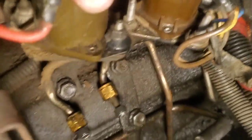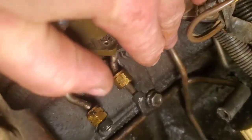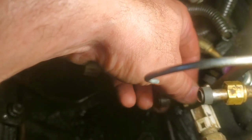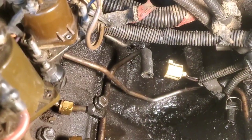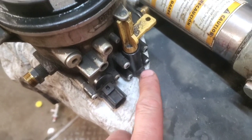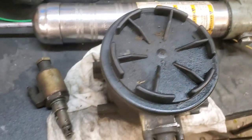I do loosen these three bolts or nuts right here — you can see how this is movable now. That allows me to get my hand in and get these two started, because these are your fuel lines. You've got this fuel line that goes to this head, and the other fuel line goes over to the passenger side head. Then you've got your main fuel inlet right here and your return right here. You've got this part that just clips on the nipple for your fuel drain — real easy to get off. Here's the fuel bowl out of here; that's where that hose clips on for your fuel drain inlet, return, and your two fuel lines.